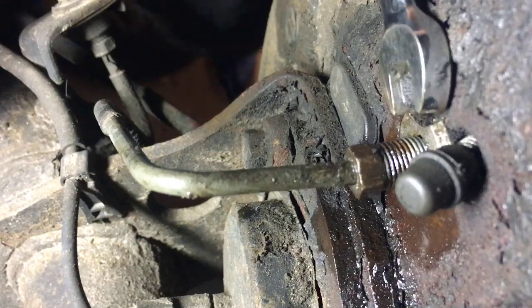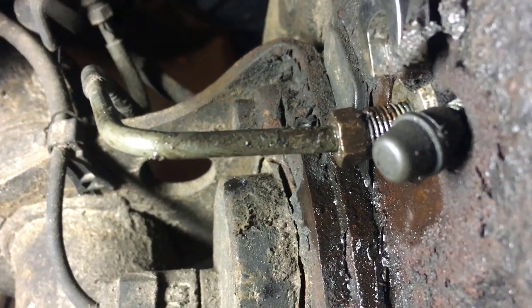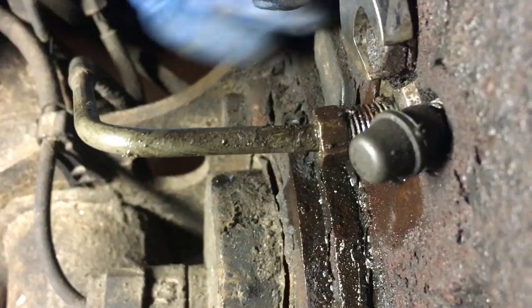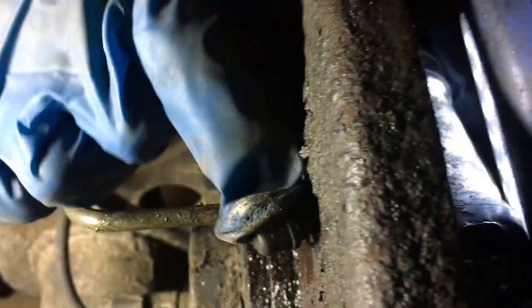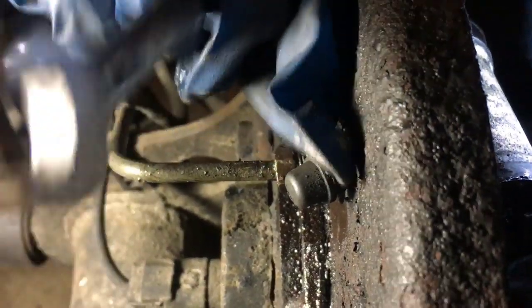This securing bolt is a number 10, by the way. The brake line is a number 12, if I recall. Once this comes out, the whole unit should come out, so you might want to hold it. If the unit is broken, you don't have to hold it necessarily, but if it isn't broken, you probably want to hold it so it doesn't fall. There should be a point where you can just unscrew it manually by hand. You can see right now that the brake line is actually dripping a bit, so you might want to put a tissue if you don't want the floor to get dirty. We took the bolt out and we can take the entire thing out.